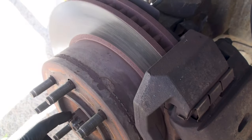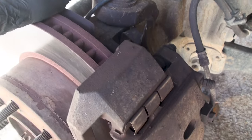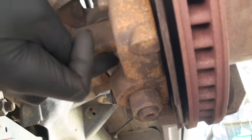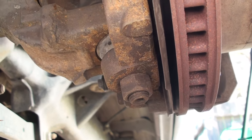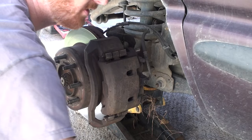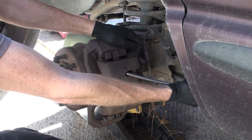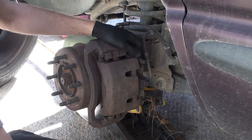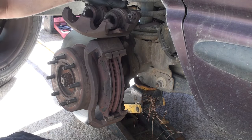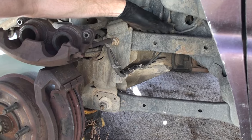The wheel bearing has four bolts that come in from the back side that hold it on. These are the ball joints — the upper ball joint here and the lower ball joint right in here. This nut will come off, and there's a keeper that holds both of these on. The U-joint we're replacing is here. Caliper bolts are 13 millimeter. A little trick — you can stick a screwdriver in here and pry to take the tension off the caliper, then hang it up with a wire to get it out of the way.